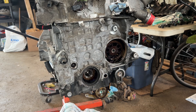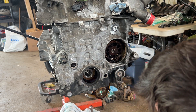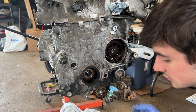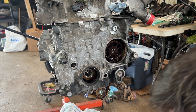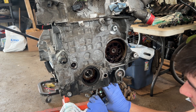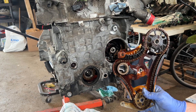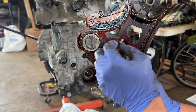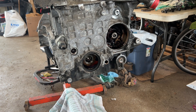There's only this bolt left. I know this isn't the correct way, but I don't have the E-Torx bits that fit, so I'm using a 12-point ratchet wrench — it's the best I can do. I assume you'd need a very thin, skinny E-Torx, but I have no clue how BMW expects you to fit one in that small hole. There we go — it's an E10 bolt but I can't fit the socket in the hole. Now that the timing system is all undone, we can proceed to flipping the engine.